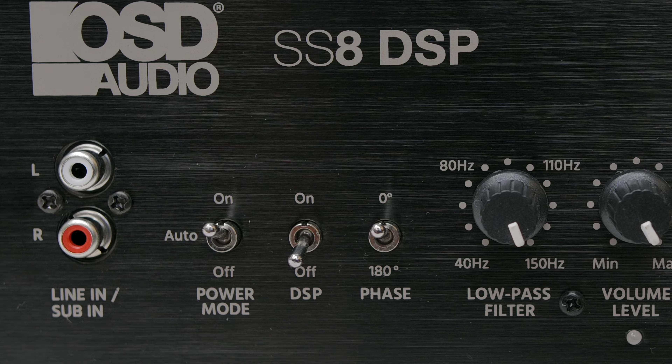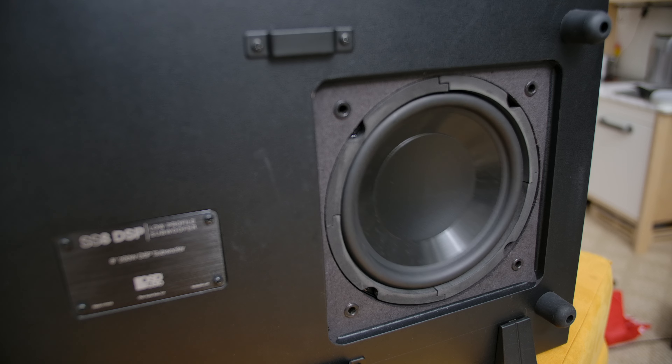Another thing I like is that you can turn the DSP off. DSP inherently adds extra delay, so if you're using a two-channel setup and don't have a way to delay your main speakers to account for that extra delay, you may want to just turn it off. That's a cool option to have. The other thing it does extremely well is it gets surprisingly loud at some of the higher bass frequencies — in the 50, 60, 70, 80 Hz region it can play pretty loud with no issue. The DSP on here with the iWoofer app does have a learning curve, and it's not the most polished app, although they're currently updating it. The pro version on iOS is $5 and unlocks additional options. Because of the versatility, it's kind of just fun to play with — an inexpensive subwoofer to mess around with and learn.